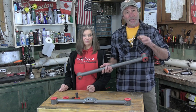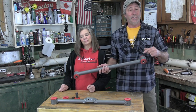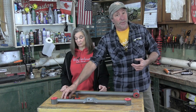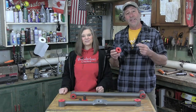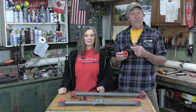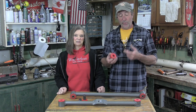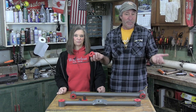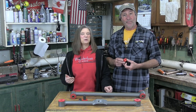What proved to us that we made the right choice was when the owner called us to talk about our choice in bushings. They offered two choices: the stock rubber type or poly bushings. I had chosen the OEM type on the order form, but he recommended we go with the poly bushings because we have the long travel and they hold up much better to the increased side load and twisting action. He had both styles in stock at the same price, so it wasn't like he was trying to upsell us. I was impressed that he took the time to make sure we had what we needed.